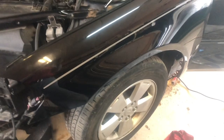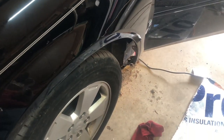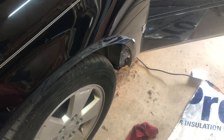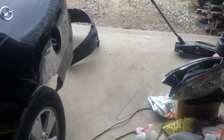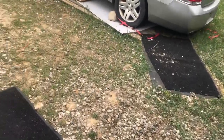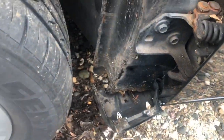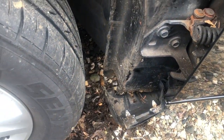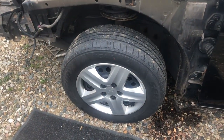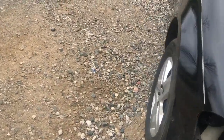We've got the fender off the parts car and I'm just starting to put it on the project car. We had some trouble getting the old fender off - there was some rust down here and I ended up having to drill one of the screws out. The funny part is on the parts car, the opposite screw was actually the one rusted off and broken off, so between the two cars we now have two complete screws. This area collects a lot of moisture and dirt, and they have a felt insulator in there that also holds moisture - that's probably why the fender rotted out.